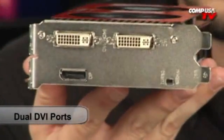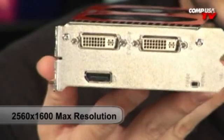Let's get right into the specs. The 4870 uses the RV770 GPU. It's got 512 megabytes of GDDR5, which stock would run at 3600 megahertz, but this one's already running at 3800 megahertz — and that's not even in turbo mode. You get 800 shaders, dual link DVIs, it will do 2560 by 1600, and multiple monitor support. Stock 4870 is 750 MHz on the core and 750 MHz on the shaders, with 3600 on the memory. In Sonic Normal mode, the core and all 800 shaders stay at 750 MHz, but the memory is already bumped to 3800 MHz effective data rate — that's 950 MHz actual since it's quad-pumped GDDR5.